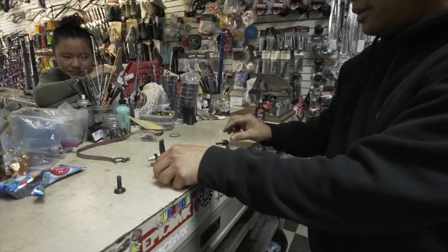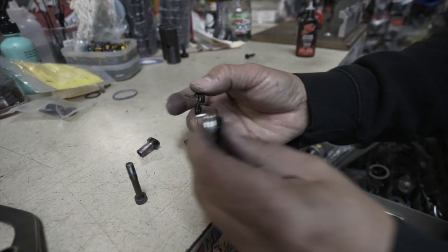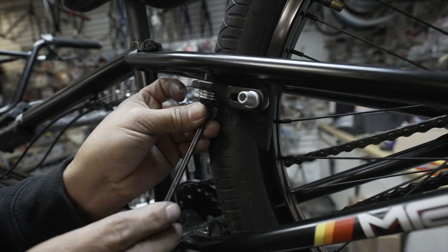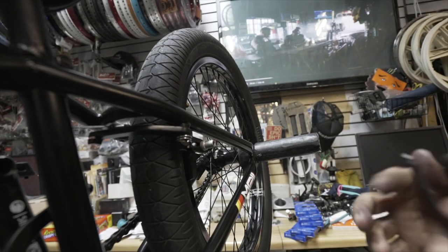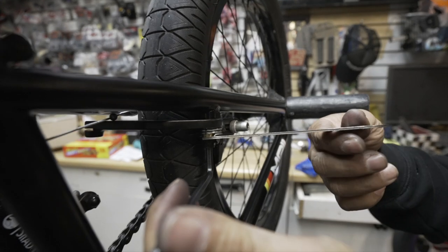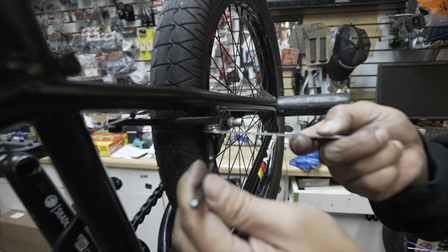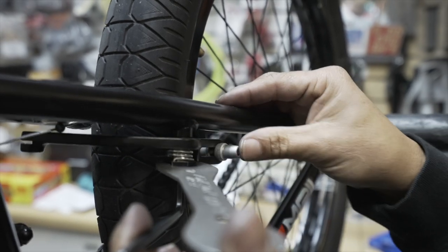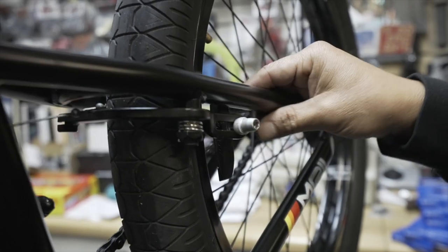Screw it all in there. Now the next thing is the brakes. I already pre-lubed this — put it in. There's a reason why both of these springs are black and this one is silver: there is a direction. Silver goes on the left side. These are the tension adjustment screws — loosen this and look. I'm going to crank it outward and watch the brakes move. As I'm going, it gets more and more. This is where my desired tension is. Tighten this, and there you go.